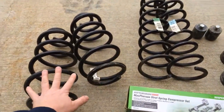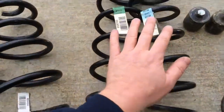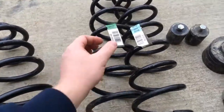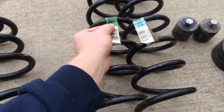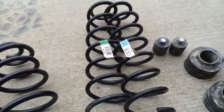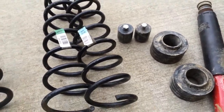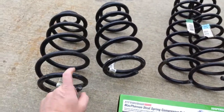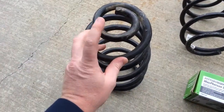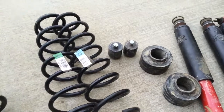The first thing is we have our springs off of our 2012 Unlimited — rears and fronts. You'll notice the part numbers on the fronts are actually different; there's a 17 and there's an 18. From what I understand, if you can actually get two of the 18s, then you might be a little better off. But this is what I've got, so this is what I'm installing. We have some bump stop extenders that we're going to use on the rears. This basically makes it so when we install our rear springs, we do not have to stretch this hole out to get it to install. Some people will actually heat this up and bend it out, but it seemed easier to me to spend 20 bucks and get the bump stop extenders.